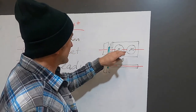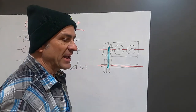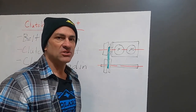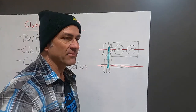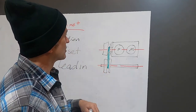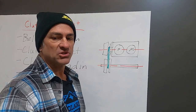But Polaris tolerances aren't real great from the factory — they just can't produce these to where the tolerances are super tight. We're seeing this lead-in all over the place: big gaps, small gaps. If you measure it and put it where it's supposed to be, it really helps your efficiency — less belt heat, less belt wear, and the most power transferring through the belt to the track. Clutch lead-in is one thing you really can't adjust unless you have the TRS motor mounts that allow you to turn the engine, because there's no adjustment in the Polaris stock motor mounts.